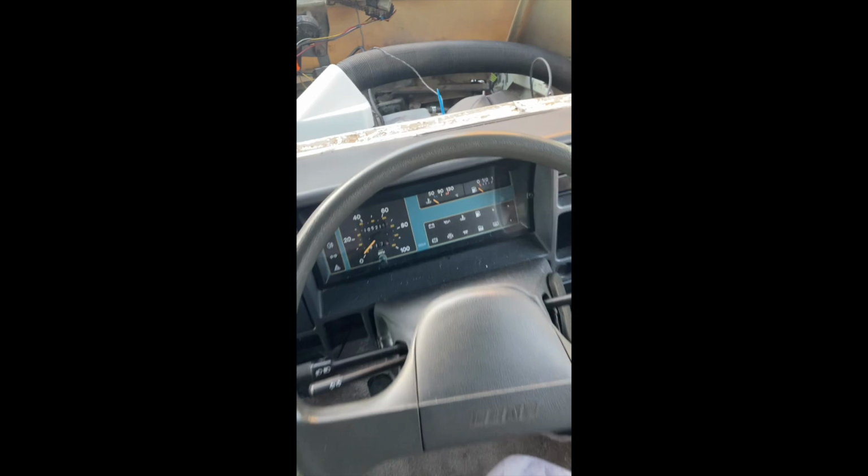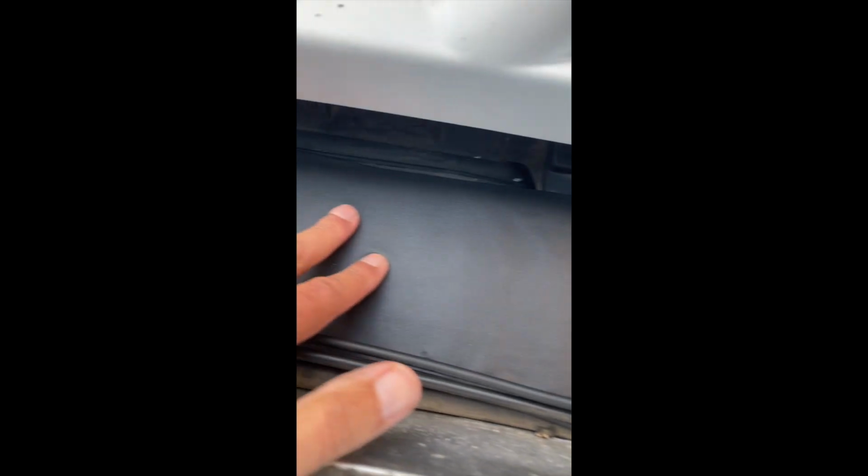Before you fit it properly, use your soundproofing on the firewall. There's extra firewall to the left and right of the main dash because the Hymer's wider than a van, so use your thick stuff there, and then use some thinner self-adhesive soundproofing all along that firewall. You're just trying to cut out as much sound as you can. It won't be seamless, but it will be better.